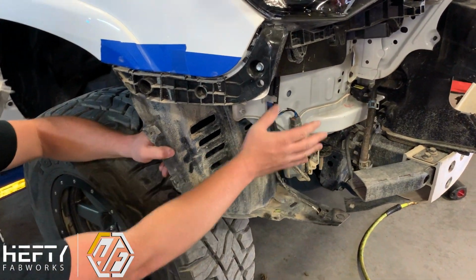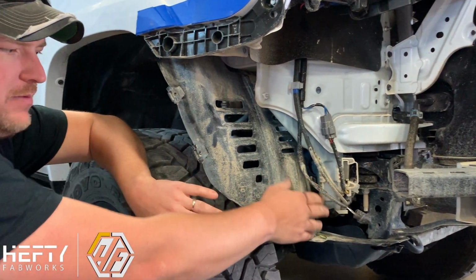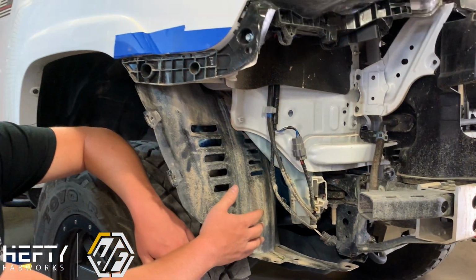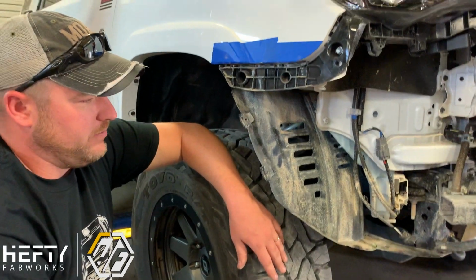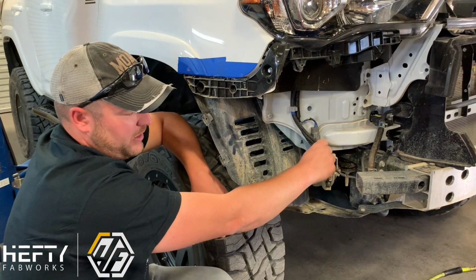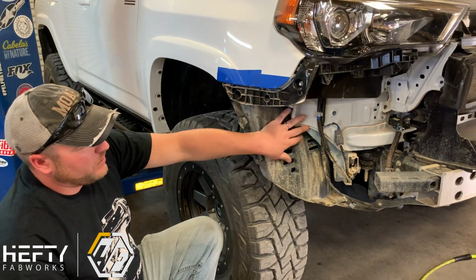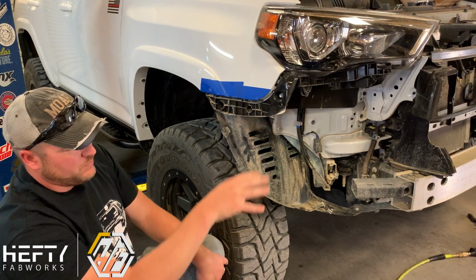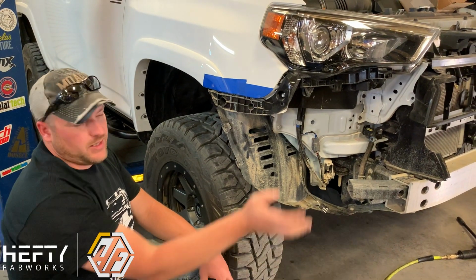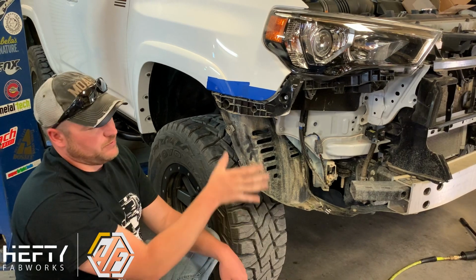What you will notice here is we do have the washer reservoir. There's a couple ways to deal with the washer reservoir. The most common, it's not really in a majorly vulnerable spot. I don't hear a lot of people having issues with them. The biggest thing afterwards is it does look ugly. So 90% of our customers, what they're going to do is we scuff it, clean it off, and spray it with some rattle can spray-on bed liner, touch it up, and then we'll zip tie all of these lines back out of the way, clean it up a little bit underneath. On vehicles like this that are white, you do see a lot of the understructure. So on this one, we'll go ahead and clean it up. We'll do the same treatment underneath and spray everything black, so it cleans it up and makes it look really clean once we do the install. You're not going to see all that white structure behind. On the darker colored vehicles, it really doesn't make any difference. You're not going to see that afterwards, but on white vehicles and silver vehicles especially, we do tend to see that a lot more.